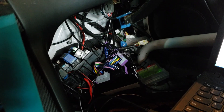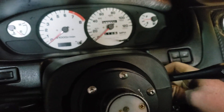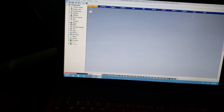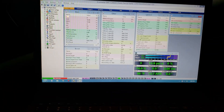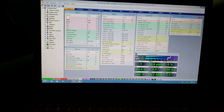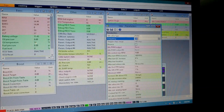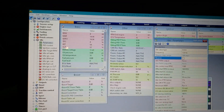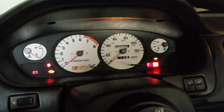I've got a huge mess in my floorboard. I don't know what the hell to do with the fuse box — that's like the weirdest place I've ever seen it relocated. I have a base map that I had pre-made already, so I'm gonna go through and make sure everything is decent. It's a PWM idle valve at 120 Hz, so we'll go with that. Flash and check it out — let's see what happens.